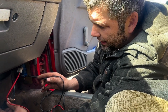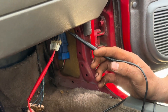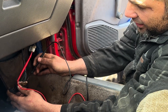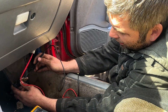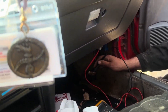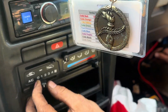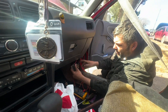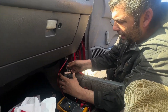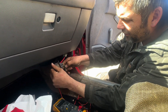I went between my power wire here that feeds the fan — it comes on with the ignition. The ignition feeds power to the fan and then the ground works the fan. These three wires here: when the fan's on zero we ain't getting no voltage, but as soon as we cut it on we're getting voltage. That tells us we have a bad blower resistor on this car. The blower resistor's gone bad, so we're going to unplug it, go get one, and have this thing done for today — if I can get it unplugged before it melts.